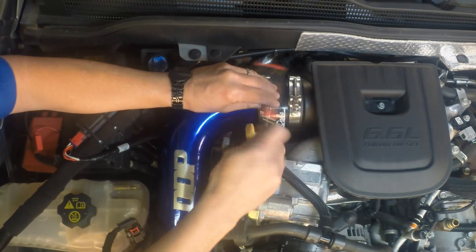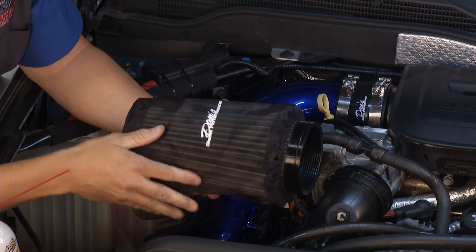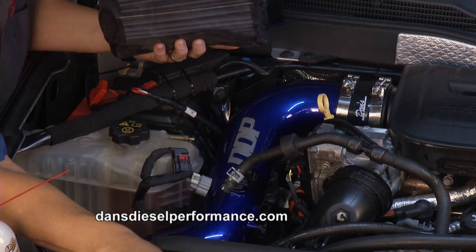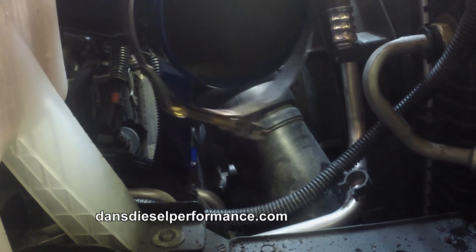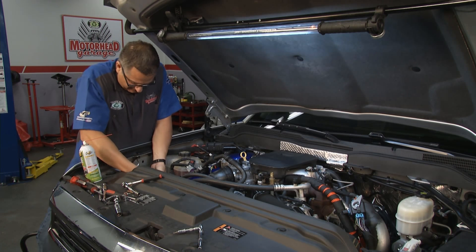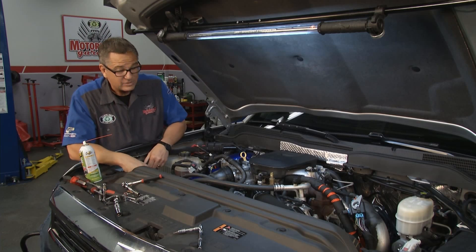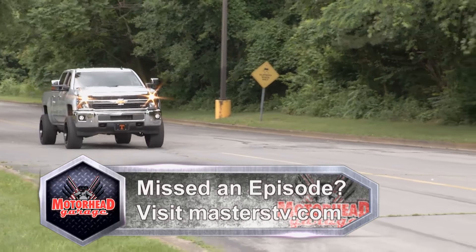So I'm going to take the cold air intake and put it in here just like it goes. Dan's Diesel Performance couldn't have made this any easier — this thing actually is perfect, it slides right in, and my bolt hole lines up down there just perfect. I'll go down and get this bolt started, back where I took it off the injector bracket, and get a couple threads going just to make sure everything's lined up. Now we're just going to make all our connections — no extenders or wire harnesses needed. I snug up this clamp at the top where it goes into the actual air box. We're talking about getting cold air in with nice smooth mandrel bends, not beating up that air and causing heat. Then I take this air cleaner with the pre-filter that Brian was telling you about — just put the clamp over that and slip it on.